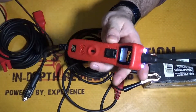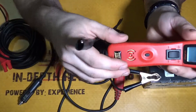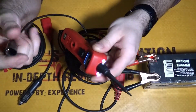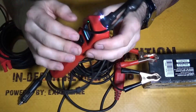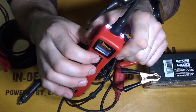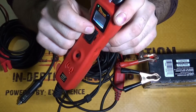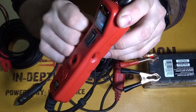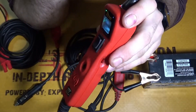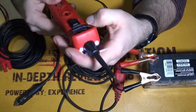There's a way to test your power probe just to see if it's still working properly. You take your ground lead — the power probe has a ground lead that is constantly grounded to the battery, so wherever you are you always have a good ground. Take your ground lead, hook it up to the tip of the power probe, and as you can see it lit up green — that's telling me my ground lead is good. Now if you want to test your circuit breaker, hit the power switch and add power to it, and it will trip the breaker. There's a couple of seconds before you can push the breaker back in to let everything cool down, and if you heard it click, that means you can push it back in. And that's how I test my power probe, just to make sure it still works.